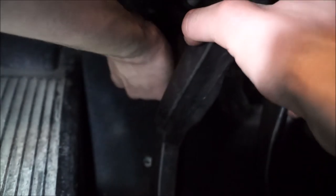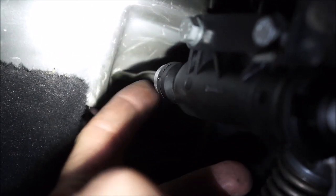We've got our clutch pedal assembly and I'm feeding this line through the hole, walking it up and in. It's up there. Now I'm getting the hole where the brake fork goes through and feeding the brake fork through that big hole. The line pops in. The brake fork is almost through — there's a click, meaning it's sitting in position. The clip is in, the hard line is on there and it won't come off unless we pull the clip. Now we need to get the assembly up onto the four studs and start bolting down.